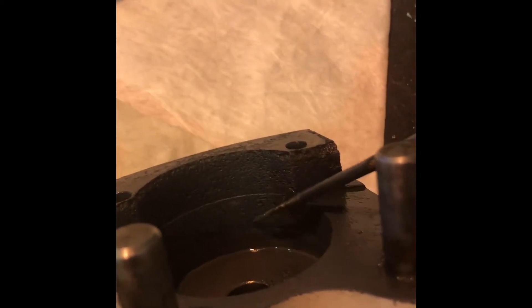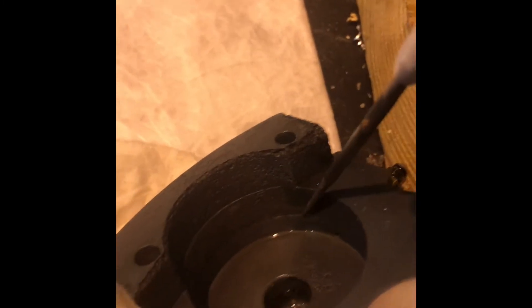Now that it's cleaned, you can see this one's kind of pitted. Give it a good visual inspection of the inside of the caliper. You can see pitting — but between here and here it's pretty clean, which is where the o-ring sits. If that o-ring comes out too far and gets into the pitted area, it'll usually cut the o-ring and start leaking. I'll service these with an o-ring for now; if it's leaking again next year, it probably needs to be resurfaced or replaced. Inspect the piston as well — any light scratches, clean up with a little scotch-brite, looking for scoring that might damage the o-ring.